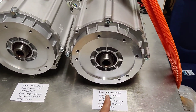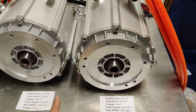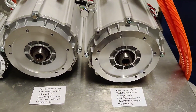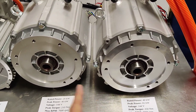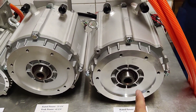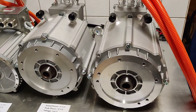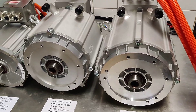For the 65 kW peak power motor, the standard prismatic battery pack is no longer sufficient — we need to increase the amps of the battery to match this motor. So we jump to blade cells for this motor. There is also an option to use prismatic cells, but then you need to double the pack size.